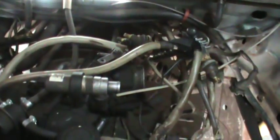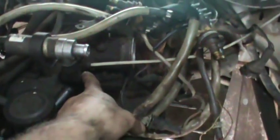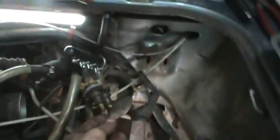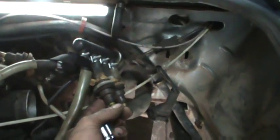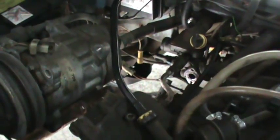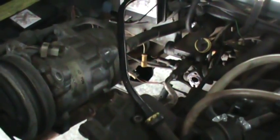Actually, backing up — the two intake manifolds: the plenum kind of stayed in place, but coming from there to the heads are the intakes on both sides. From the head side there were two bolts, and the intake just pretty much lifted up and came out. There was one bolt in the center of it for the injector rail, and that held the center in — just pulled that straight up and out of the way, and did the same on the other side with the fuel rail and intake manifold. Both of those came up and out.